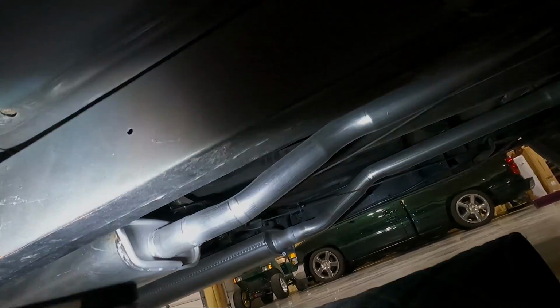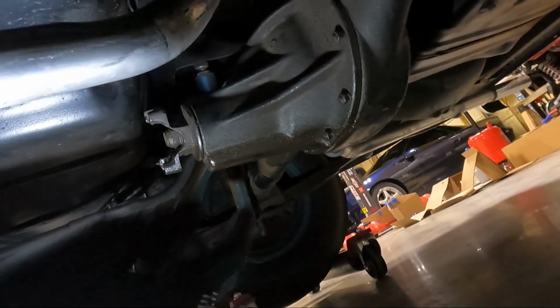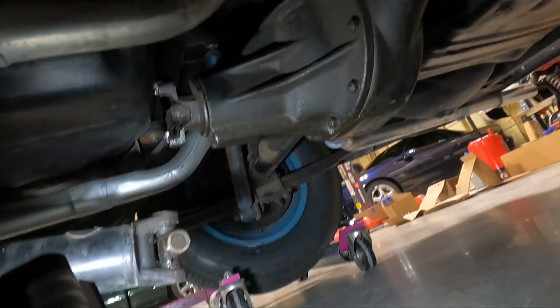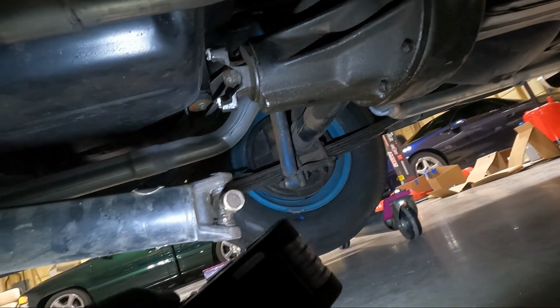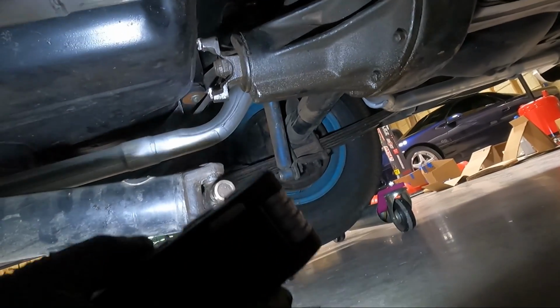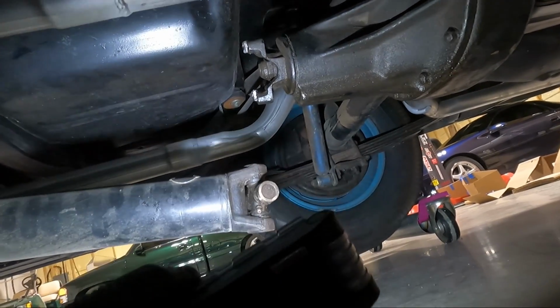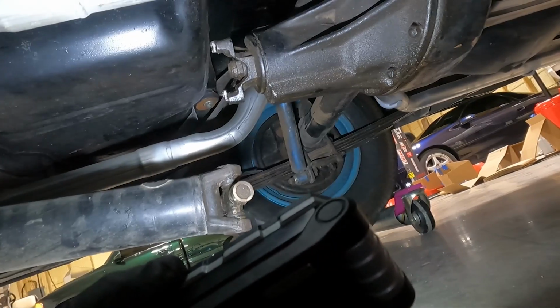And then I'll move up front and show you guys around the transmission itself, because right now I'm kind of on the side here. These are kind of interesting rear ends. For one, they look like 9 inches the way that the center section bolts in there, but the straps come in, there's bolts or nuts on the backside, and the strap goes around. So it's way easier to pull it out once you get those loose. So we've got that loose, and it's just sitting there. I'm going to leave it right there for now, and we're going to move up to the front around the transmission.